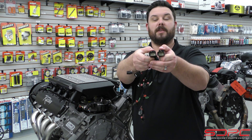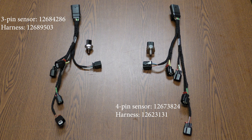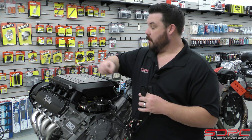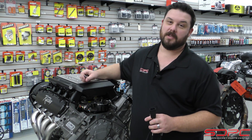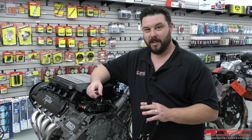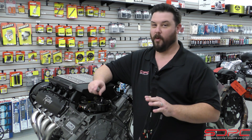It's going to be hard to see, but the connectors are exactly the same. So you can plug in a module kit or controller kit for a 3-pin into a 4-pin or vice versa and cause a lot of issues. One of the great benefits about the Gen 5 LTs is how technologically advanced they've become, but that means we need to pay extra special attention when we're wiring one up.